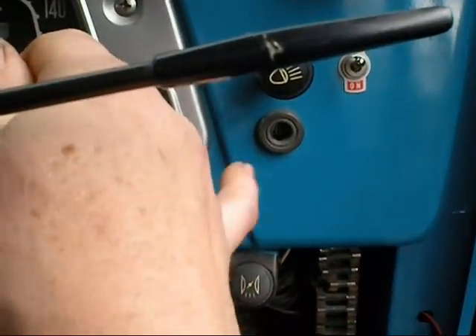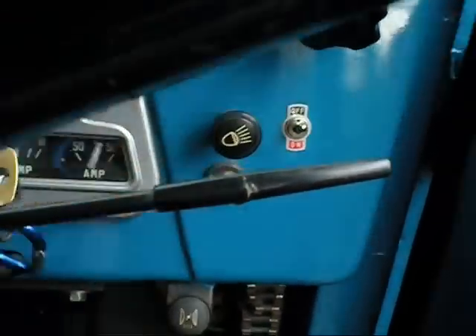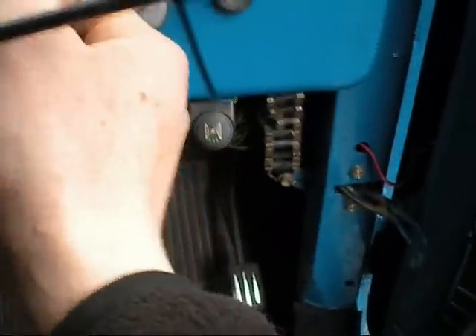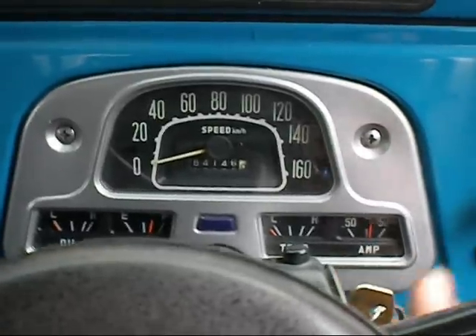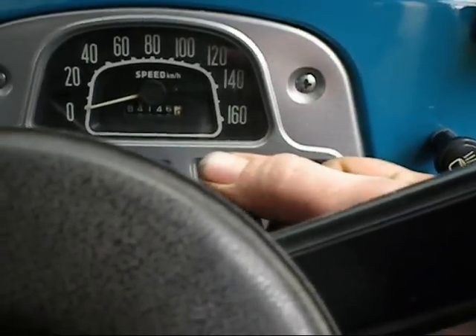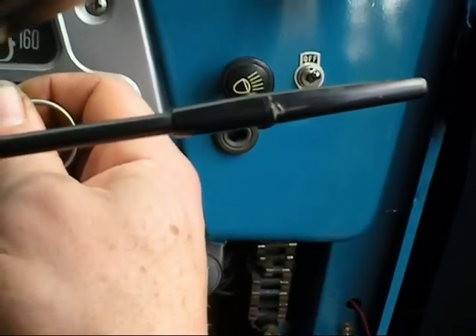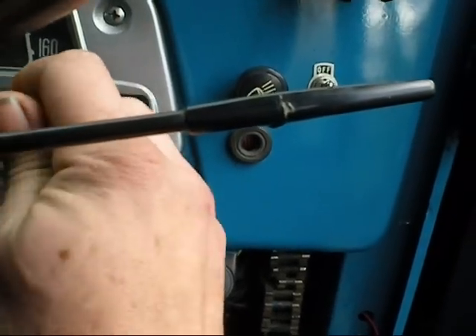You glow it and the little thing becomes red. See this now — make sure it's in neutral and turn the fan off. Don't touch the gas at all, just turn the key. It'll run like shit for a bit, then turn it off, because otherwise it'll just sit there kicking about doing horrible things to itself. Glow it again. I'm just going to repeat this process, but don't glow it too much or you'll cook the plugs.